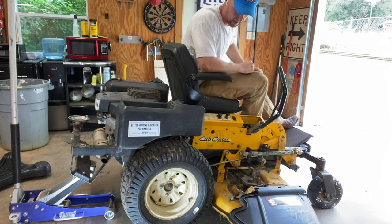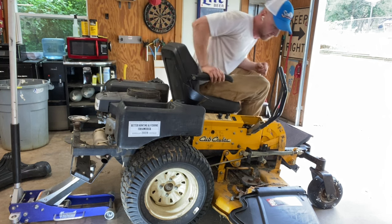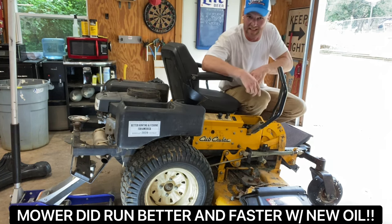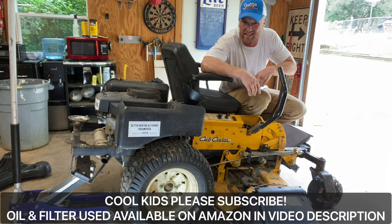Let's go ahead and give it a whirl in the yard. Make sure when you're done to check the hydraulic fluid to make sure it's still filled. You might have to do it a couple of times, but that's it. I hope that helped - that was a fun one. I like doing this once a year just to keep the transmissions running smooth and good. With that, Bower and Mike out - you guys have a good one!